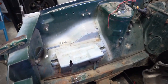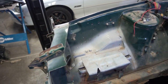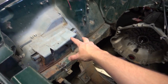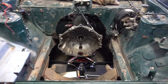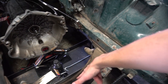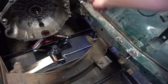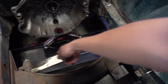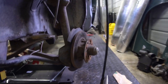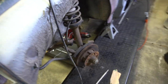A lot of what I need to do is come back in and finish welding up my engine mounts. I need to cut this whole battery tray out and smooth it because the heater lines and exhaust kind of hit back here. I'll look at everything else to see what I can smooth out in the engine bay. I'm going to cut the original mounts out for the rotary engine. For steering, I need to come up and be in front of the K-member — I need to get everything spun around so I can use the little steering link off of it.